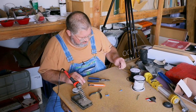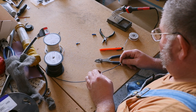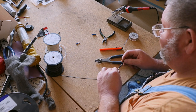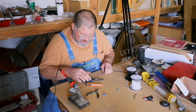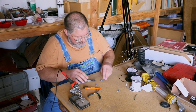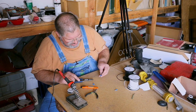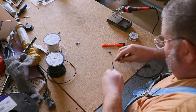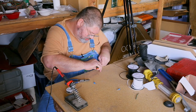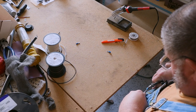So what we're going to do now is make up our wiring. So we need a ground wire that goes from the choke to the housing on the carburetor, then we'll use this white wire for ignition power. Now, a little trick I like to do is with these crimp connectors. You can see I got the soldering iron out, so you know I like to solder them. But when we're working on these old cars, these colored pieces of plastic on the connectors look bad. They don't blend in under the hood. Take the connector and slit the plastic. And usually then pull it right off.